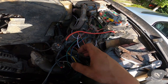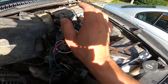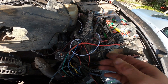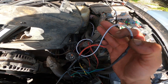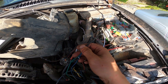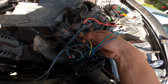I did this my way — you don't have to do it this way. These computers are wired for two fans supposedly. When I tried wiring my two fans up, I've got a constant ground on my second fan input, so I just scrapped the second fan idea and tapped the two kicker wires together. These are a kicker ground — this white wire is fed to my ECU at pin number 42 on the blue harness. Pin 42 is your number one fan control, so I have blue and green connected to my white, and my white goes to pin 42.